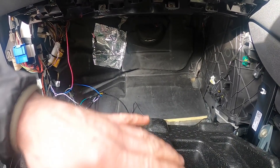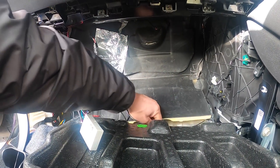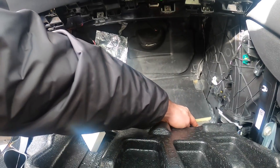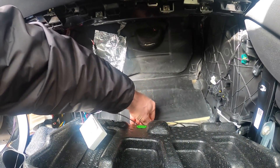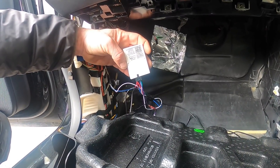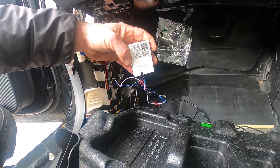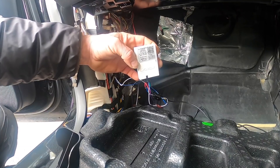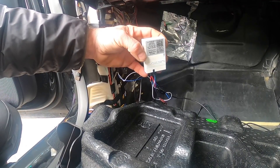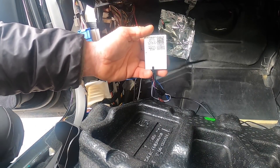In the car, this is the nearside front carpet pulled down. You can see the sound deadening, and behind there is the grommet where all this wiring needs to come through. Fortunately this kit comes pre-wired so all the switches are in place. You do have to wire in this CAN interface here. We did have to use what's called an iUI to flash this to the latest software, because the Model 3 had done a version 11 update and the CAN speeds changed, so it was no longer picking up the right CAN speed.